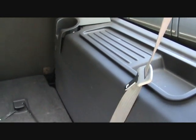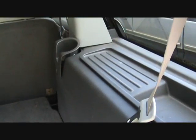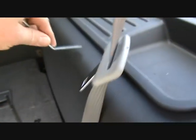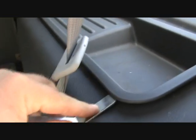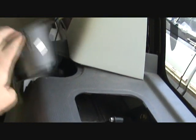So I took this little trim panel out. They'll say you need a little kitty claw trim tool, but I just used this — it's a wrench for tightening blades on a skill saw. I stuck it under here and just popped it: pop, pop, pop. You could do the same with a flat screwdriver, but this has a wider tongue on it. I just popped all that out, and do the same thing with the cup holder.